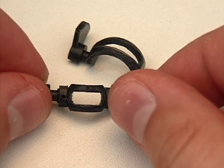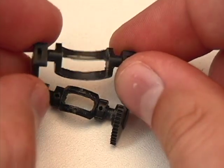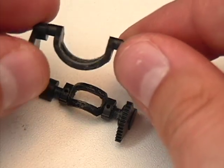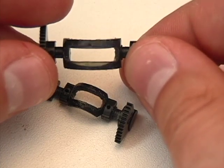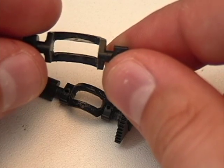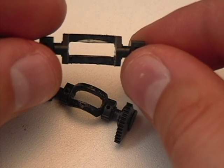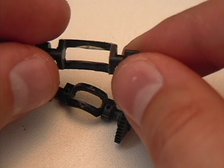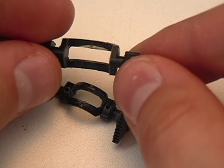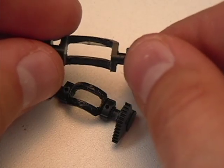If the insides of these black pieces are worn away, it's necessary to build them up with something. I used two glues: a two-part epoxy glue and then super glue. On the smaller left-right movement piece I just used super glue because it dries really quick and really hard, and then I can file it. On the larger piece there was a lot more plastic missing, so I used a two-part epoxy glue to roughly and coarsely fill it in, then topped it off with super glue. The two-part epoxy after drying - which took about a whole day with my low quality glue - was a little rubbery, so I topped it off with super glue. You could find a better type of glue, like a liquid metal type glue that dries really fast and is also really hard, making the second super glue application unnecessary.